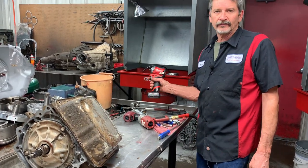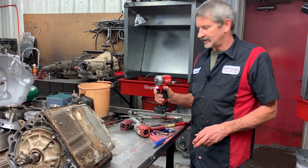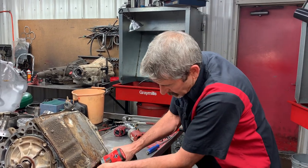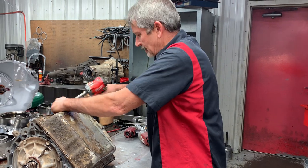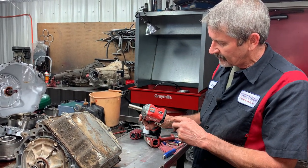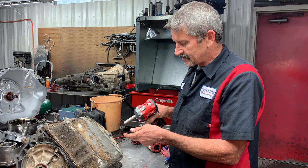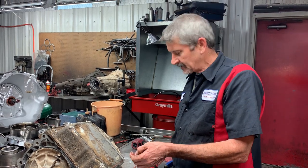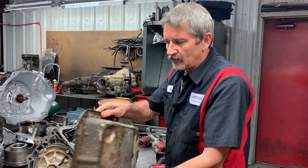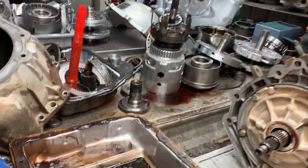We do have our Milwaukee 3/8 impact here. I figured out how to work it - got the settings on high. This thing works really nice. It's got low, second, and third mode, and then it's got a sensitivity mode when you go to tighten it down. No more than it senses a load on the bolt, it turns off instantly. I like that because then I can put my pan bolts on without squishing them, and without wearing my speed handle out all the time.